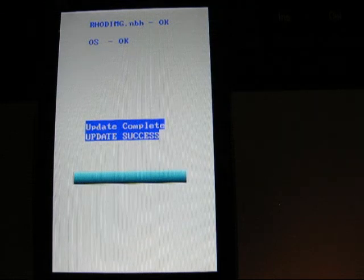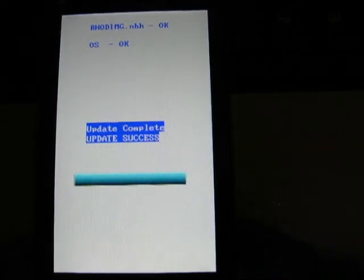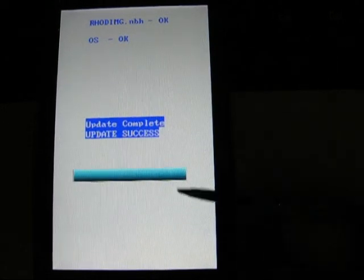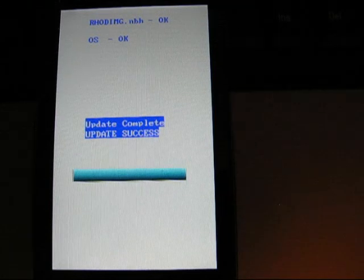I could do a demo for a couple hours to show you that this won't move until you press the reset button. Now what I'm going to do to continue the installation process is hit the reset button. Remember what I said — this is the safe point. When you get to here, you can disconnect the battery and your phone is going to be okay. So now I'm going to hit the reset button so that the installation process continues.